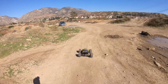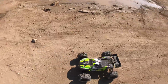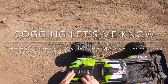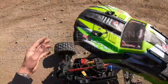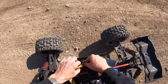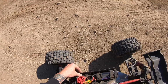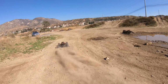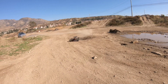And it's got cogging in reverse. That's cogging. Let me unplug the sensor wire. It's got 2 beeps now. And I have had these sensors go bad inside these Coke can motors. That's exactly what it is. The sensor's failing in the motor again.